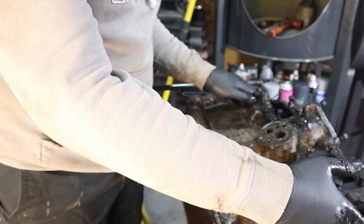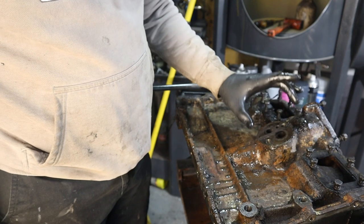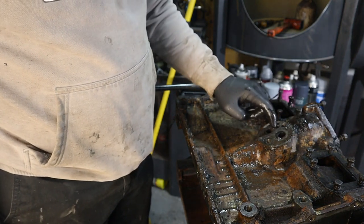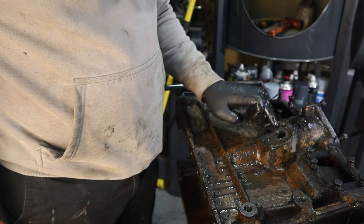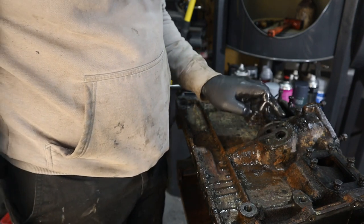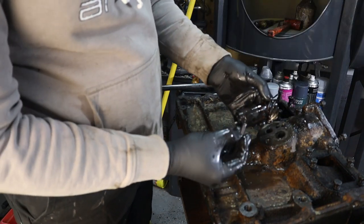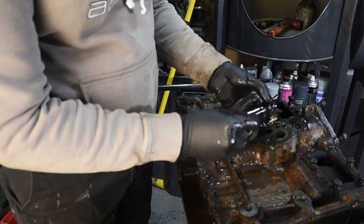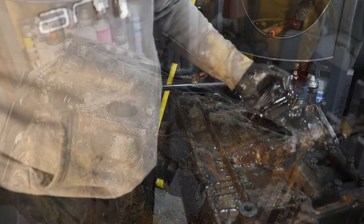So before you can take the cam out, you have to remove a small shaft that sits in here. And to remove that, you need to take out a screw from this hole, which is a flathead. Mine came out with a little bit of difficulty and some WD-40. The shaft comes out from the top, and here's the screw. The screw sits that way in that hole there, which lines up with that hole there.